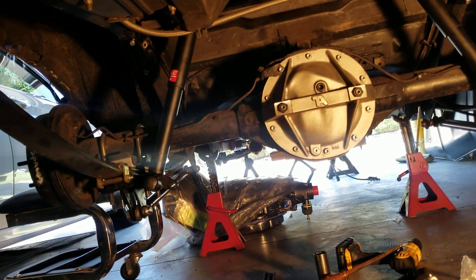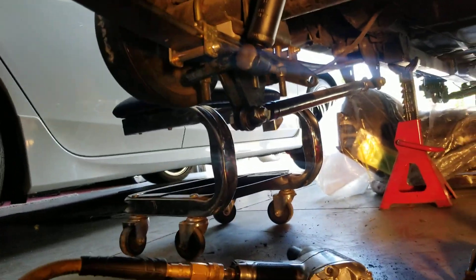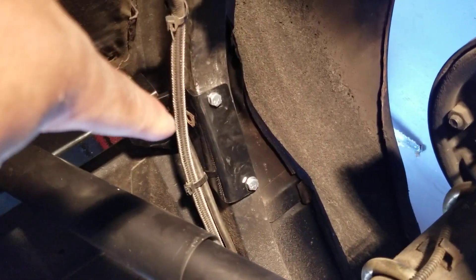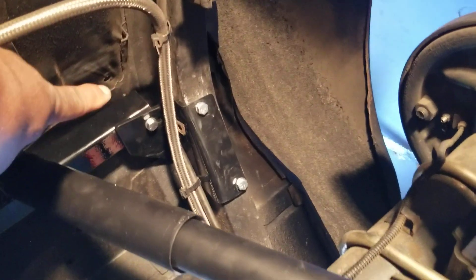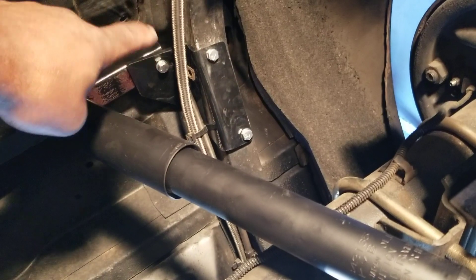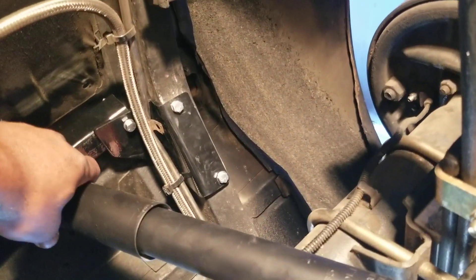The kit is pretty simple and easy to install. You got the crossbar up there and you got the brackets — the brackets replace the bump stops. I gotta get grade 8 bolts, plus all this is gonna get welded up. I don't trust just bolts. The fuel lines will get moved out of the way a little bit.